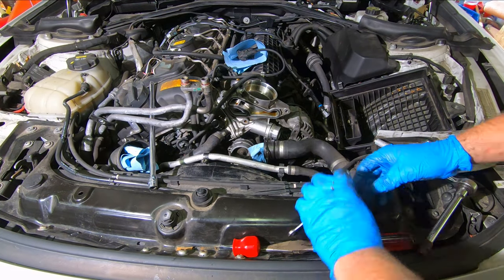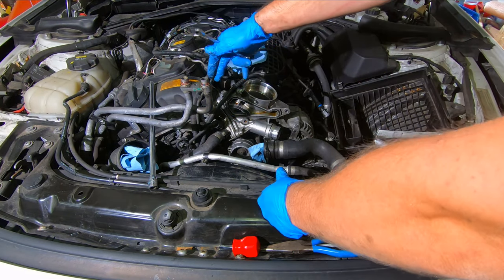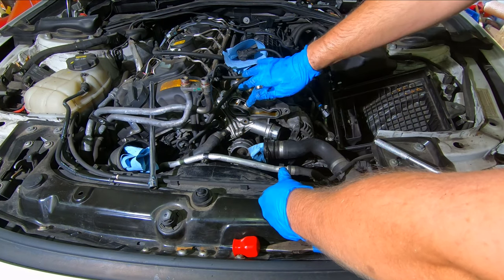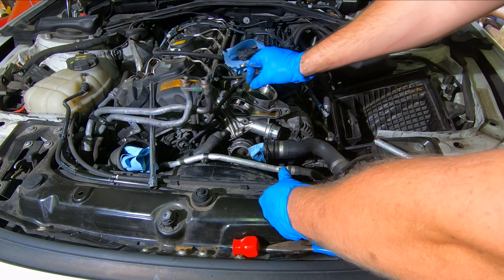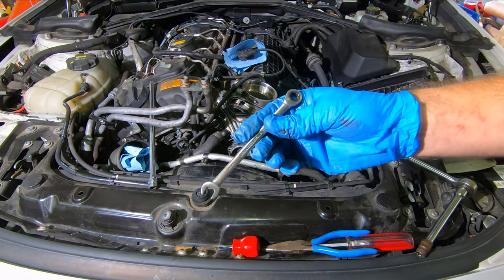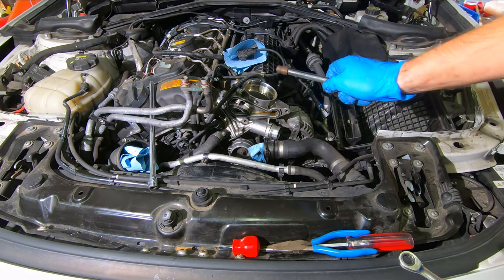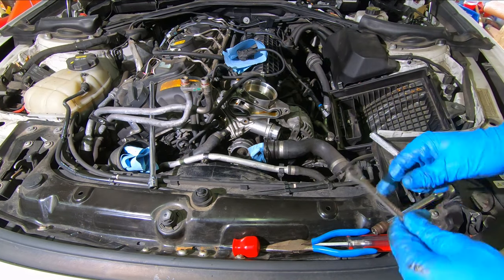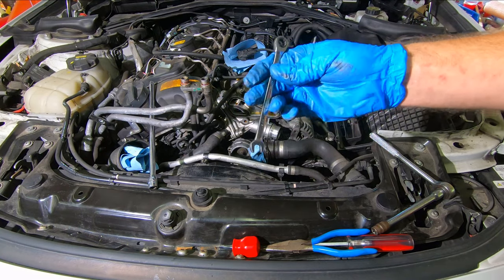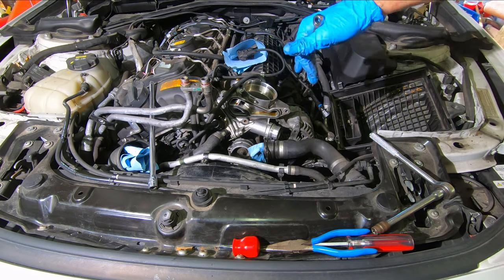I installed the three bolts to mount the housing to the engine. One thing you want to make sure is that you don't tighten them down one by one — put them in at least halfway so you still have room to maneuver the whole thing. I used the 8 millimeter again on the back bolt because when I tried to use the socket at that weird angle it didn't feel like it was going in right, so I backed off and loosened the other two bolts a bit more. I'm going to torque these to spec and include all the torque specs in the description as well as in the video as I go along.